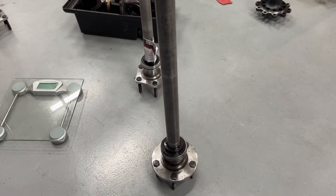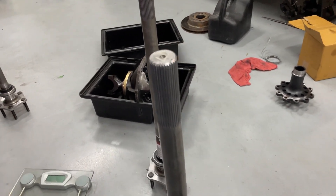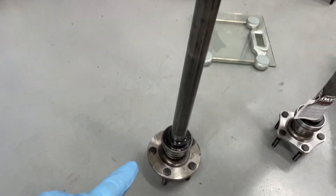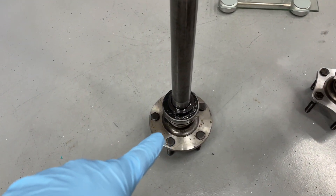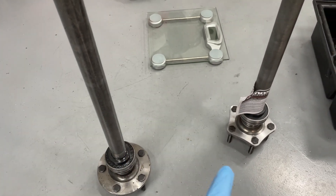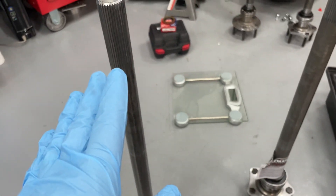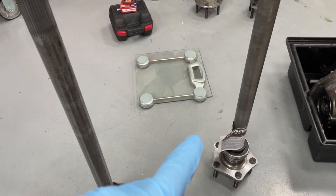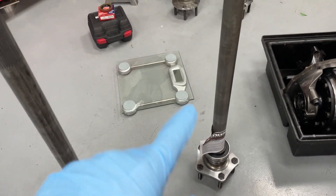I ordered it from Quick Performance about a year ago when I did it, and I ordered it with 35-spline axles. These are the ones that came standard — they're 35-spline Mosers. You can tell from the flange how it's round and circular. What I did is I replaced the axles, not because these got torn up or anything, but because of my own stupidity, which I'll show you in a minute.